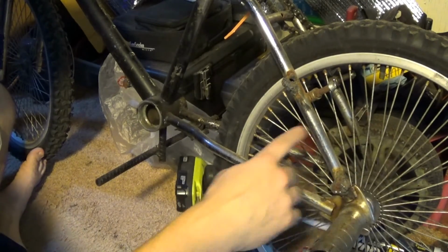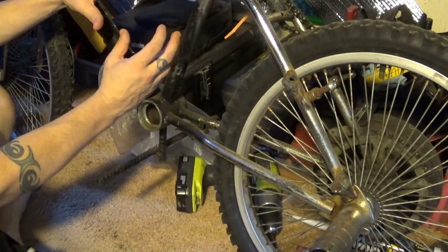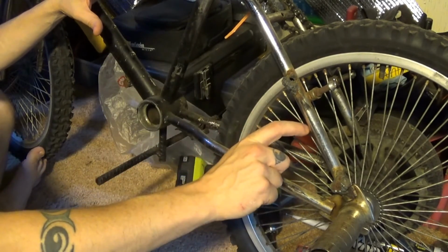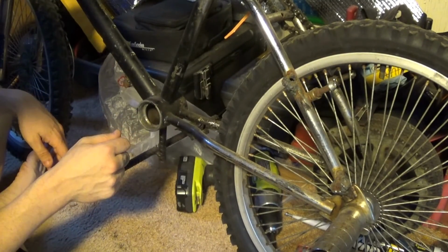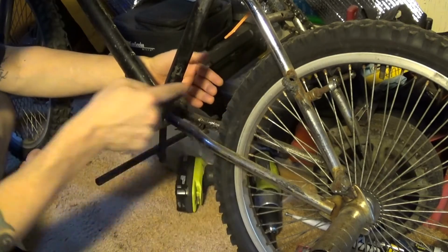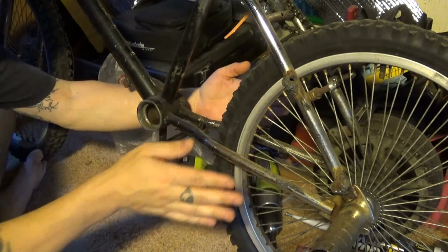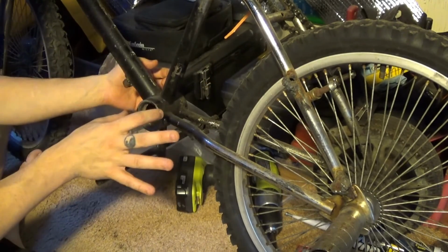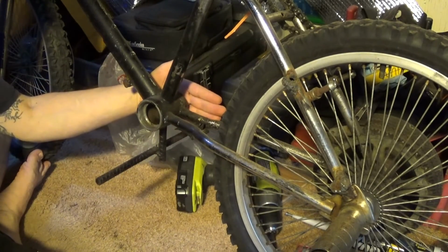I would add a 420 sprocket on the back and then just have one chain to deal with. A 420 chain going from the back 420 sprocket up to the motor, and just deal with two gears, making it simple that way. But there's not a clear path back to the rear sprocket. The natural path of the bike chain goes straight to this hub. So I think it will be easier just to put a couple sprockets on a lower bracket, run the bike chain back, because I know it's got plenty of room. The bike chain is skinny, the 420 chain's a little bit bigger, and I'm just uncertain if that's going to fit going back there. So I'm going to do this kind of weird setup where the big 420 chain comes down here to the lower bracket, and then on the other side, there will be a bike chain